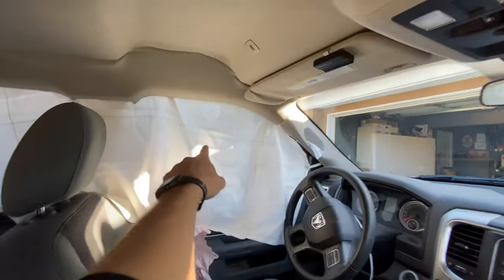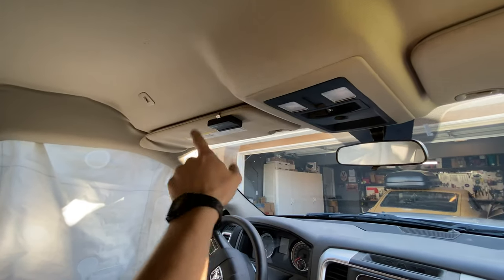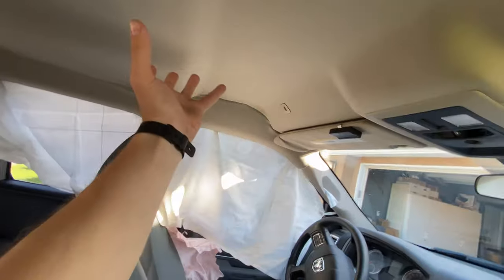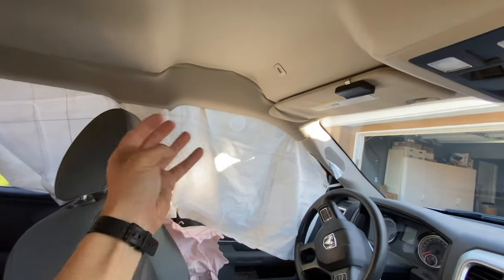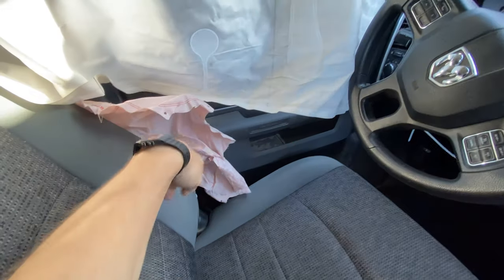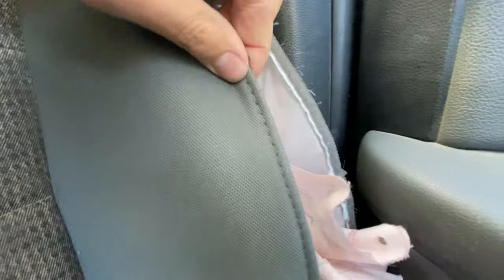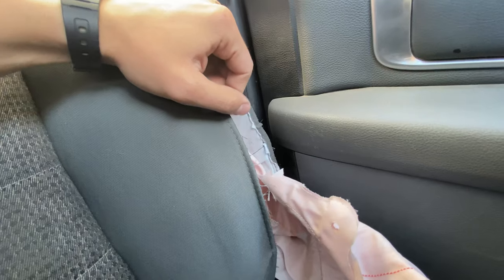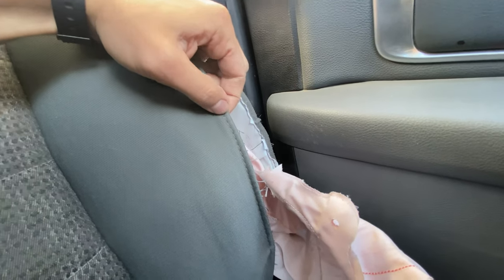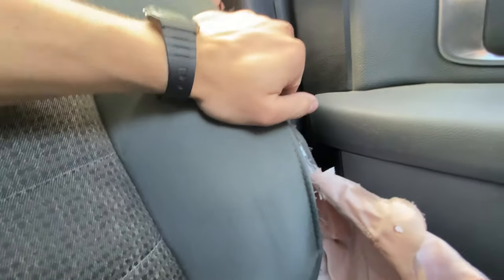The way we're gonna replace the top one is the headliner actually has to come down. So we have to pull out all these little things, unbolt the headliner, it will just kind of come down. We'll put the new one in, put the headliner back up, voila. This one will just pop out and plug right in. It'll actually be really easy to replace. But once it's replaced, we then have to stitch up this hole. You can see that the seat is completely ripped open. So we're gonna try to sew that up. I got some heavy duty seat thread off of Amazon. I'll put a link to that in the description and we're gonna sew it up with that.